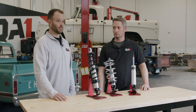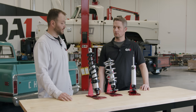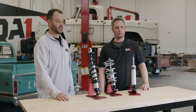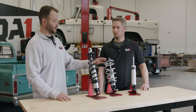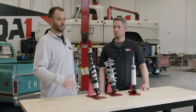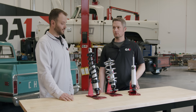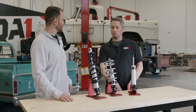There are a number of aftermarket Mustang II front ends out there. When determining the proper coilover fit for an aftermarket front end, we have to be aware of some differences. Often that front end is designed with different geometry — the shock placement may be different, and the ride height needed may be quite different from the off-the-shelf Mustang II setup. For that reason, we often need to take measurements and get weights on the vehicle to determine the appropriate shock and spring setup for the intended height and ride quality.